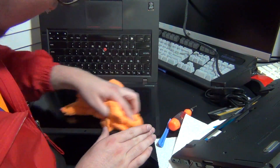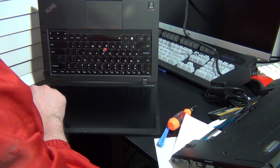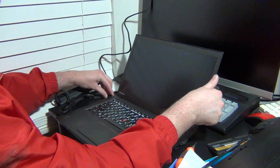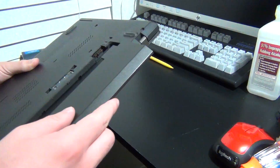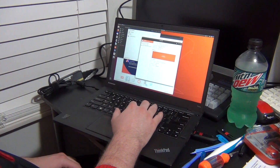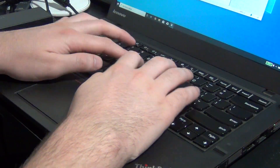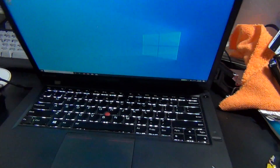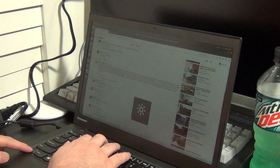Once everything's aligned and you're satisfied with your work, congratulations — you should have a working ThinkPad without having to buy a new bezel or display assembly. At this point, if you unplugged the internal battery, you can plug it back in. Once you plug the power adapter back in, the internal battery should be re-enabled. You can put the bottom cover back on, reinsert the external battery, and now we have a perfectly functional T440S. This process works on many newer ThinkPad models, and I'll leave a list in the description of all the models I know this works for. Hopefully I was able to help make replacing the display in your ThinkPad a little bit less stressful. As always, I hope you enjoyed the video — thanks for watching.